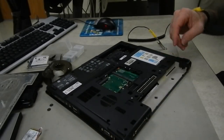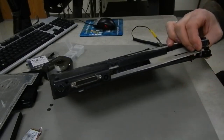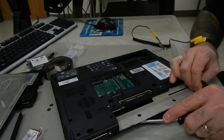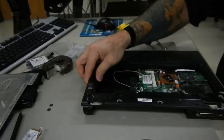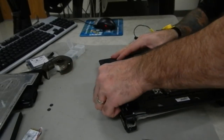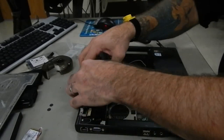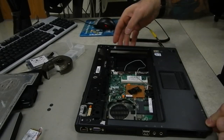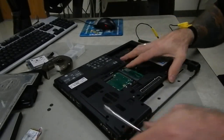At a professional repair place you don't want to send your laptop and have it come back with all kinds of chew marks on it. With the first clip loose you can see how it's starting to come apart — just take a screwdriver and run it along here, gently prying until we get the next clip loose. Sometimes it's a little bit easier to pull from along the side, get fingernails underneath, and you can hear the clips as they release all the way up to the front.